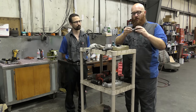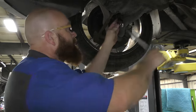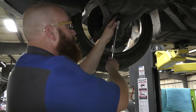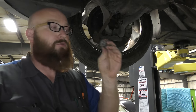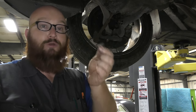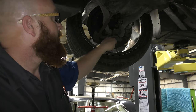This is the old ball joint. I actually had to cut the nose off to do this job and I'll show you why in a minute. First thing we're going to do is remove the nuts. When you get the nut off, don't throw it in the trash. I actually like to reuse these because the nut that comes with the new ball joints is actually a little smaller. These are much stronger — they've got a large shoulder on them. The nylon inside for the nylock is still very tight; if you can't put it on the whole way by hand, it's still good.